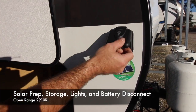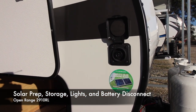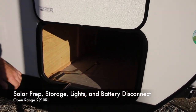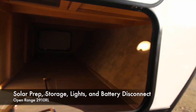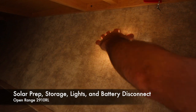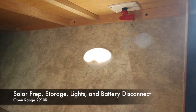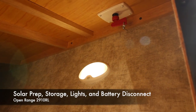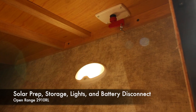On the front side here you're going to see a little solar charge port. You can buy a solar panel that will plug up to this, which keeps your battery charged for your 12-volt stuff — great for dry camping or as a trickle charge. You also have pass-through storage. There's a light here with a switch on top: position one keeps the light on all the time, position two makes it a motion light. Right next to the light you'll notice a little red handle — that's your battery disconnect. Turn that off when storing the unit and it kills all power to the battery, except the propane sniffer which is wired directly to the battery.